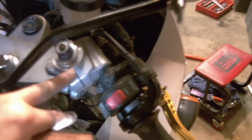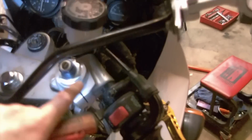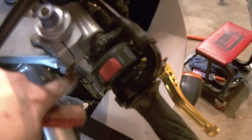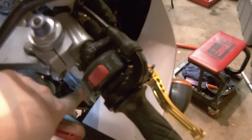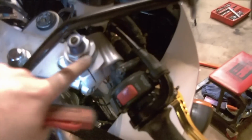However, you want to loosen these pinch bolts first because they're putting pressure on the threads where these would rest, so we don't want to turn against the tension on the outer tube pushing on the threads of the cap. So after we loosen these pinch bolts, while we're still held here, holding the fork stationary, but these 2 are loose, we can crack the caps loose ever so slightly to make it easier to disassemble once the leg is removed from the motorcycle.